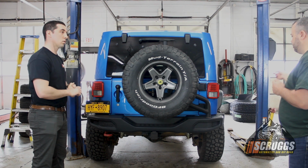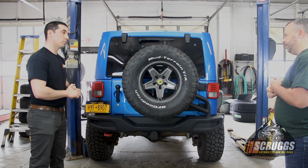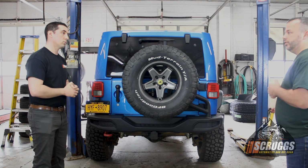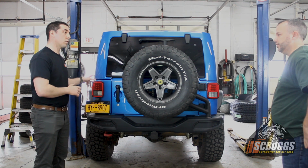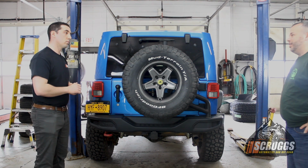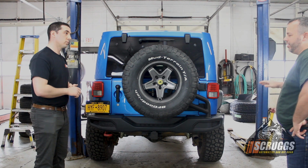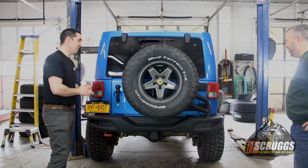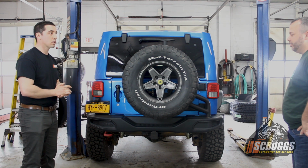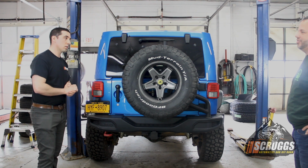When I bought the truck, I checked all the brakes. The rear brake pads were paper thin, so I replaced those. I did actually find a set of used rear big brake kit, so I have that, but I was going to wait until I do the fronts and put the whole big brake kit on the truck all at once. Do you feel like you have an issue with braking now, or do you just want that extra security and stopping power? I'm not an aggressive driver, although I have told people who have driven the Jeep, the best way to think about the brakes is they're going to slow you down, but they're not going to stop you. I just towed a decent load, probably at the 3,500 pound limit, and you had to plan for when you were going to brake, because you couldn't just say I'm going to stop now.